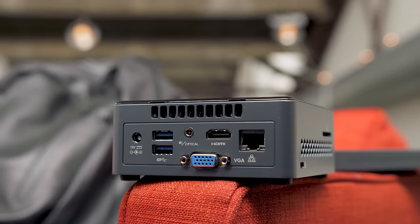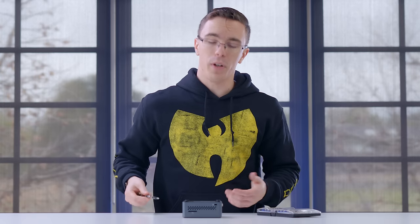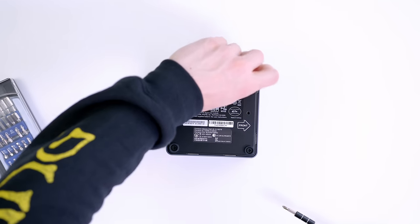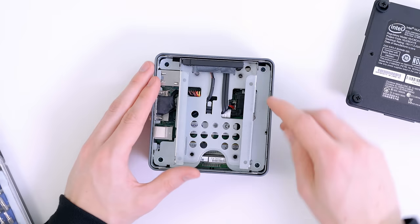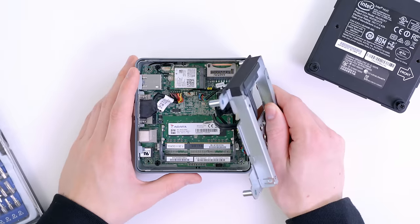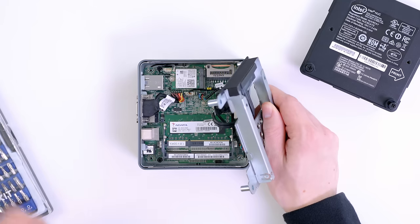Now that might not sound like a lot. However, not only can you upgrade to Core i3 and i5 models if you need more horsepower, but you can also easily upgrade this with additional RAM and storage. The NUC is meant to be fairly easy to open — if you get a bare-bones version, you actually have to open it up to put in memory and a hard drive. Even this ready-to-go model has upgrade options. Take the four screws off the bottom and you have access to the two-and-a-half-inch drive bay. Below that, you can get out the Wi-Fi card — which this already has installed — but also the memory. This NUC has two gigs of RAM pre-installed, but it's easy enough to pop that out and upgrade to four or even eight gigabytes, no problem.